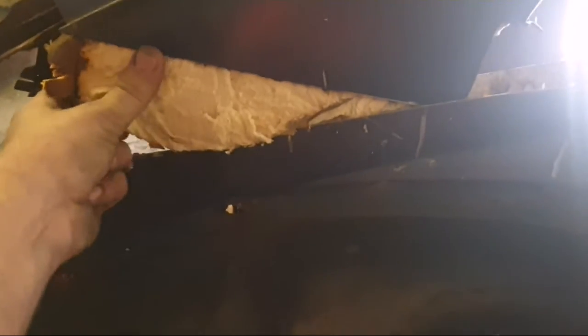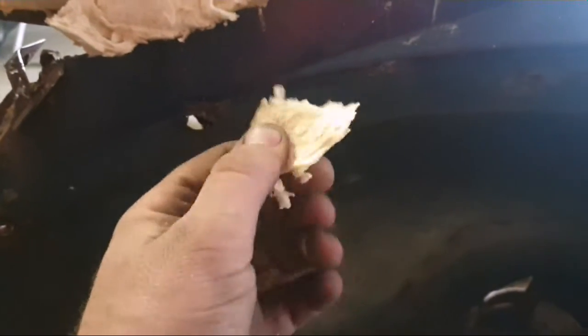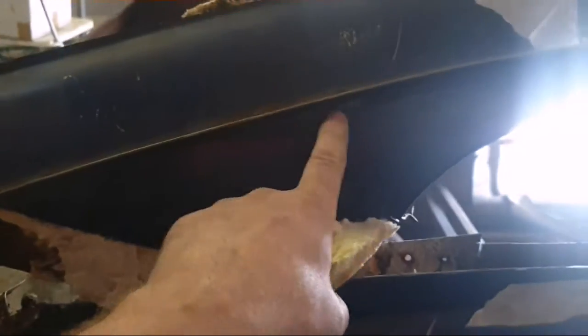I'm going to point out this lovely builder's foam that Volkswagen used back in the day. It is flammable, but it just sits there smoking for days. So if you do get any smoke, just soak it and get rid of it. It is crap for welding - causes most of the rusting in all the seams all the way up. Once it's damp it's there forever.